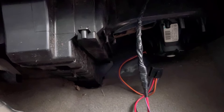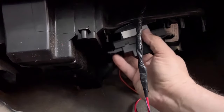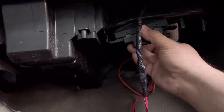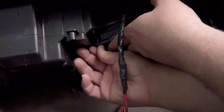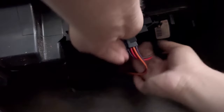Now it's time to hook up the fan and twist it back into place. We've got our new harness in place, and we're going to test fit this first to see which way the bolt holes line up. When I turn it around this way, those bolt holes back there don't line up. Always test fit since this is an aftermarket part. There's screw number two — nice, snug fit. Harness plugged in. We'll tuck these wires up and out of the way and reinstall our protective cover.